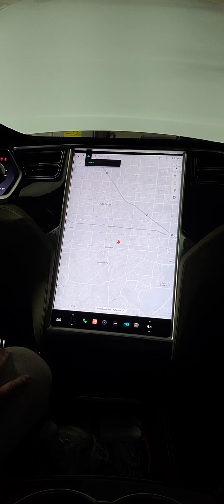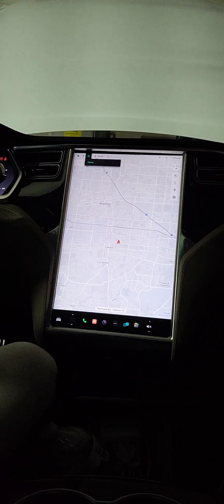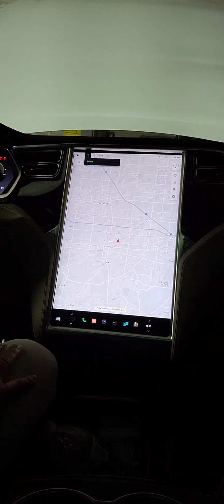The car was sitting last night, and when I went to charge it I noticed it had dropped to 27%, which triggered that error code again. I've been trying to get rid of it and have cycled a couple of times with disconnecting the low voltage and the fireman's loop, but it hasn't cleared yet — though last time it took quite a few tries as well.